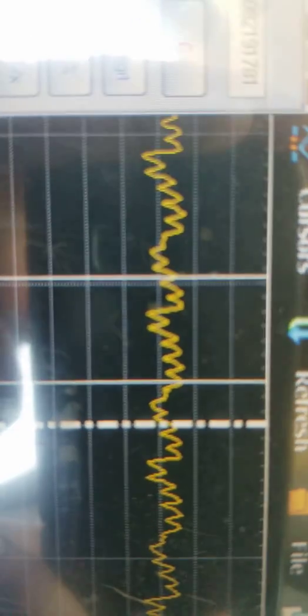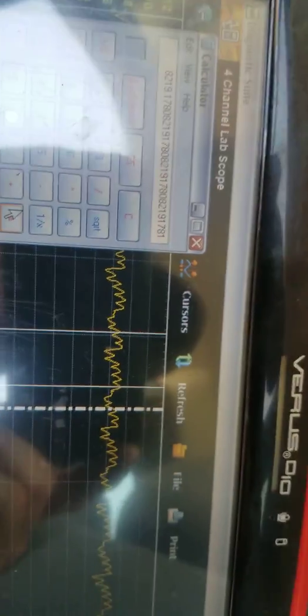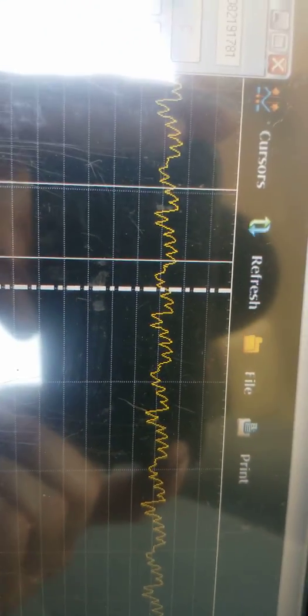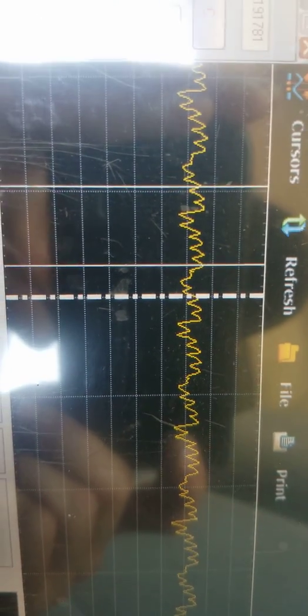I don't like the look of the waveform, so that's something to advise a customer of. But outside of that, it's fixed. It just needed fuel. We'll let the customer know. I'm obviously going to suggest a pump because of the sending unit issue, but that's about it, guys.